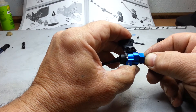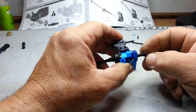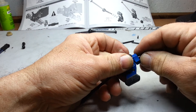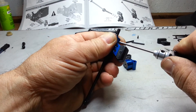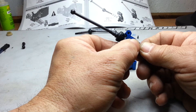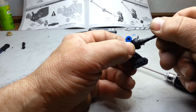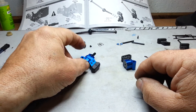Let's see if it's got any play. You've got the crush tube inside there — it should hold up just fine. This one feels like it could be just a smidgen too tight. You can loosen it up and then just reset it. If you get these pinched together too tight, what's going to happen is you're going to wear out one of your bearings. That's pretty good right there — tight but not over tight.